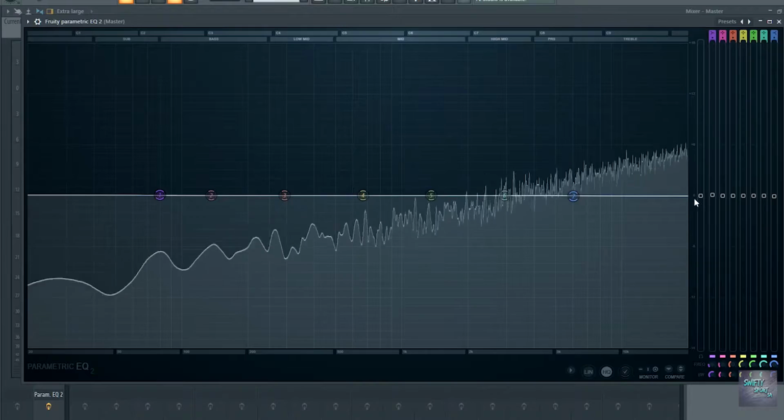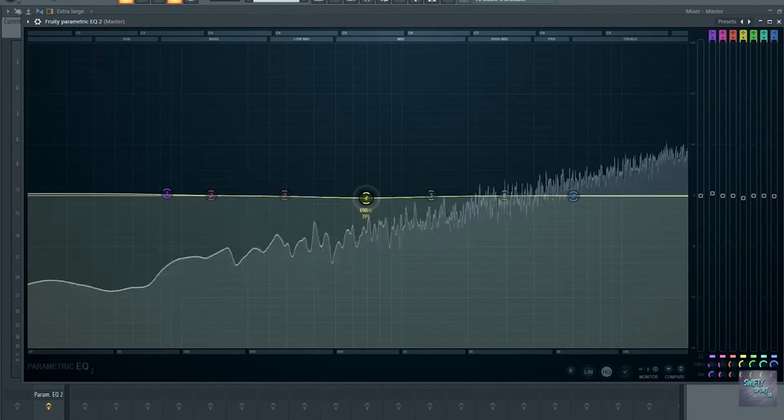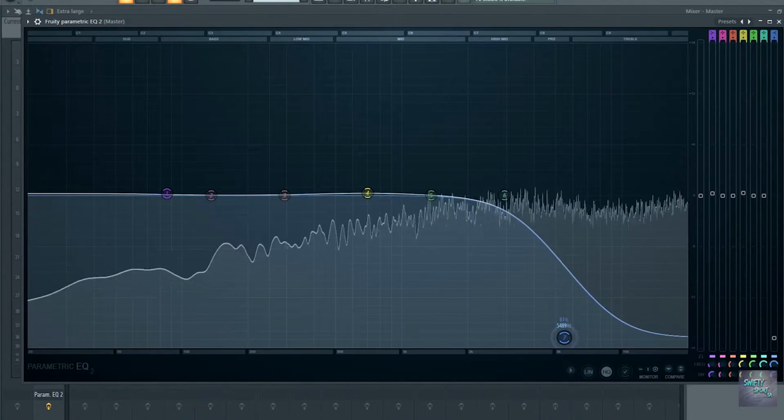And obviously a lot of engineering has gone into that from your manufacturer on your stock exhaust. Now on your exhaust, you may find one resonator or two resonators. Basically, a resonator is designed to lower sound level as well, but for certain frequencies. You might find short ones, you might find long ones. They are all designed to eliminate certain frequencies coming from your engine, together with the muffler at the very end, which lowers the entire level altogether.